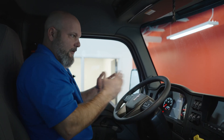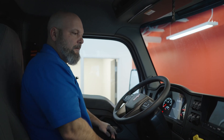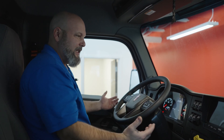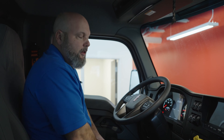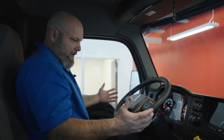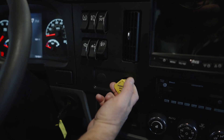If the light is on the dash while you're driving down the road and the light comes on, you get to your next stop and find a safe place where you can be sitting for 30 to 40 minutes, because that's how long the manual regeneration is going to take. Get to your safe spot, pull over, put the truck in neutral, and set the parking brake.